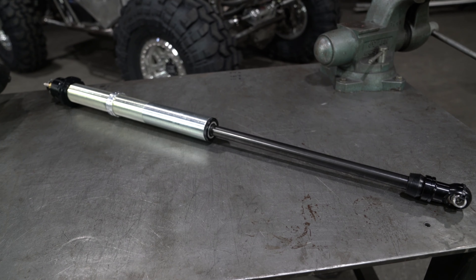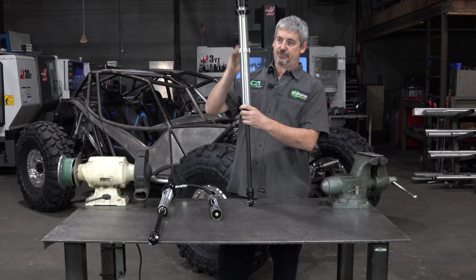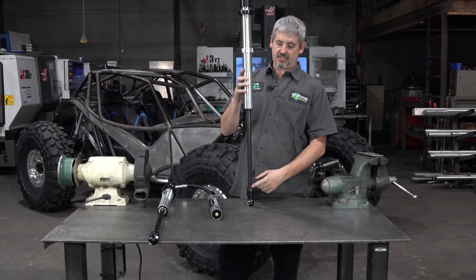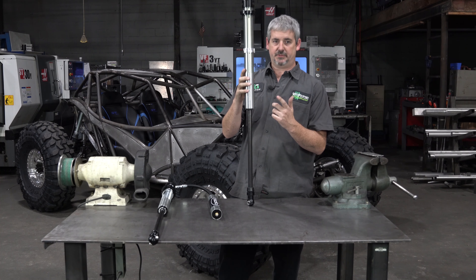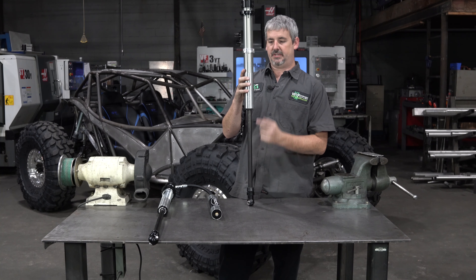One other thing on an emulsion shock: you have a tube that's got nitrogen, oil, and you're inserting the shock shaft inside it. As the shock shaft goes up into the body, you're going to feel what seems like a spring rate increase — it's not really a spring rate increase, but that's what it feels like. You're putting the shaft into a pressurized body and it's going to want to force the shaft back out. I've seen it act as a bump stop, which is really nice; I've also seen it spring the front end of a buggy back on big climbs, which is not nice. It can be an advantage or a disadvantage, but for most regular slow rock crawling you're not going to notice it at all.